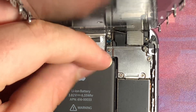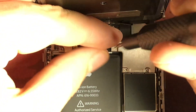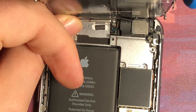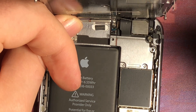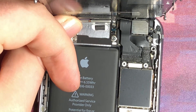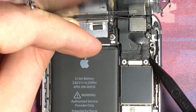Now that you're done with that, move up here — same idea. There's this little bracket thing that holds the pieces in place. Make sure not to put too much stress on these ribbon cables here holding the display. The next thing you're going to want to grab is these tweezers. Then lift up this panel and set that aside. Now we have a bunch of these little connectors here — we're going to pop these up just one at a time.